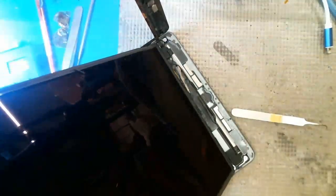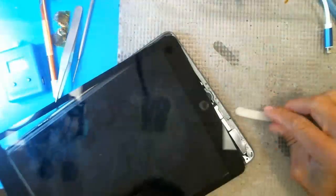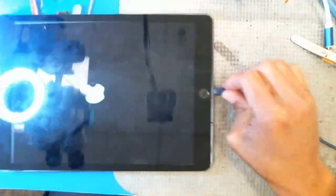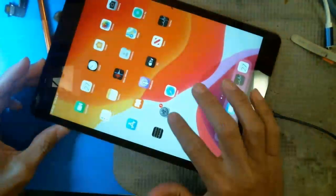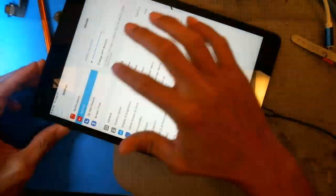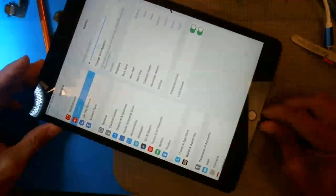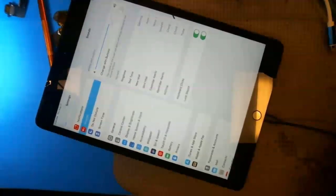Put the battery screw back in and test everything. Alright — two amps, Apple logo. The charge port appears very similar to the other ones; it may take just a hair longer for disassembly and reassembly. I check sounds for the speakers, and charging is at 2.5 amps. That's how you do the iPad 7th generation charge port repair. It was fairly straightforward — I didn't see a crack in it, but the charge port was still bad.